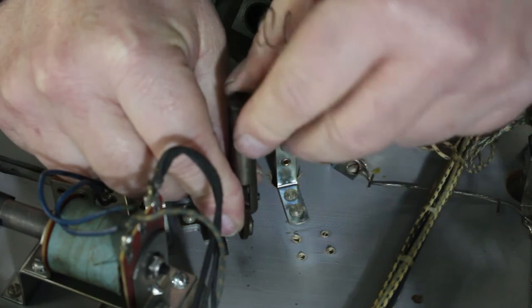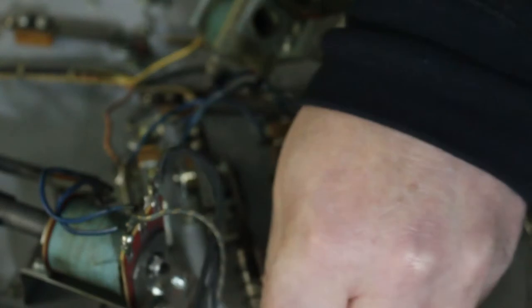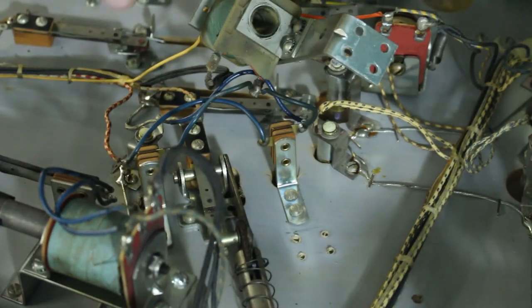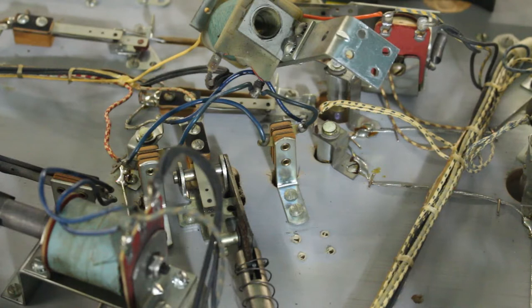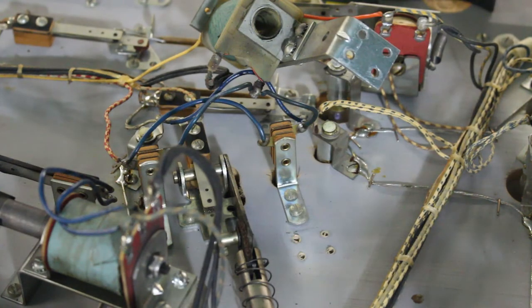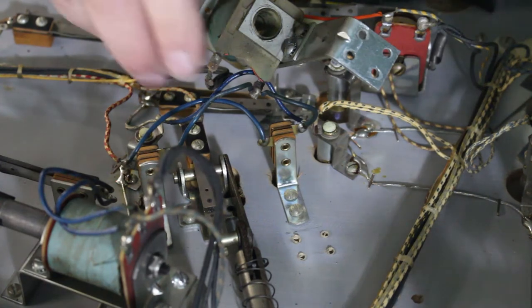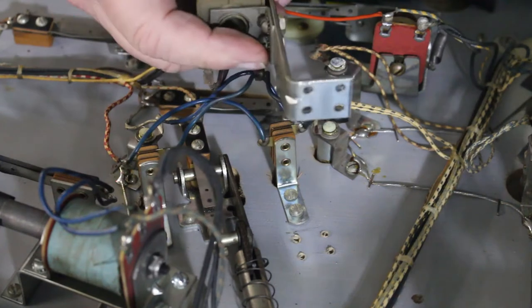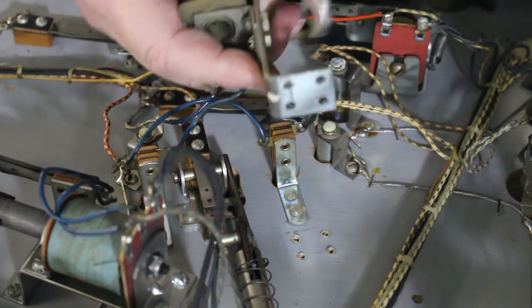That one's pretty good. It still has a beveled edge on it. It's not all flattened out or mushroomed. This is one of the kickers, one of your side kickers. The side kickers, they get used a lot. So those ones I definitely would change. But best thing is when you get one of these old machines, if it's been sitting around, and oh, when we put it away, it was working. Yeah, that's fine, but the longer they sit,